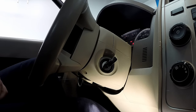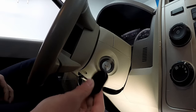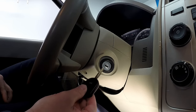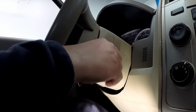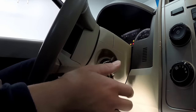Wait for the light to go solid and then go out. At this point, turn the key off — you're out of programming mode. Go ahead and try each one of your keys. It's a good idea to make sure all the keys are still programmed and you didn't knock one of the others off. That's kind of rare but it does happen. Let's try the new key first — starts right up — and then the other keys.